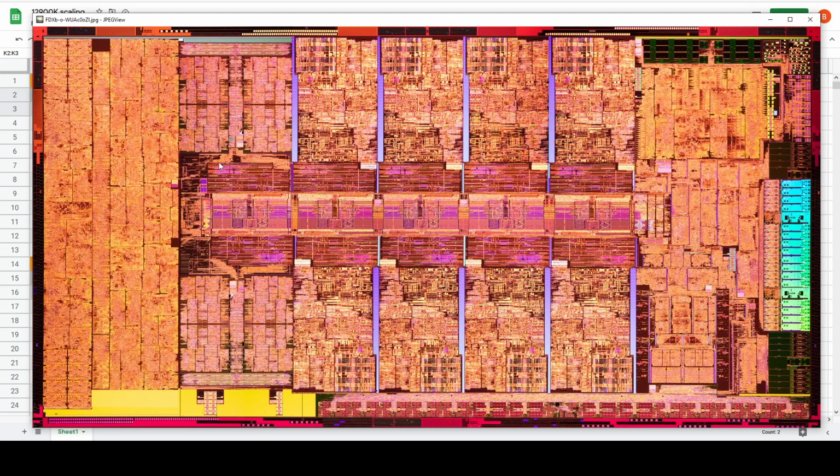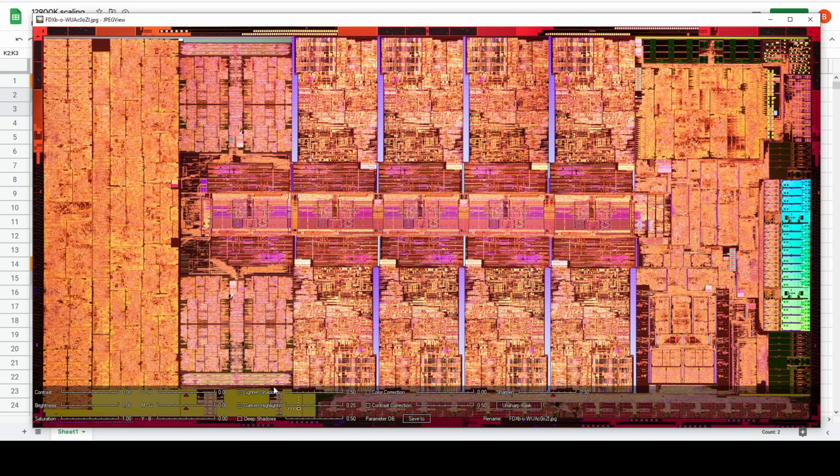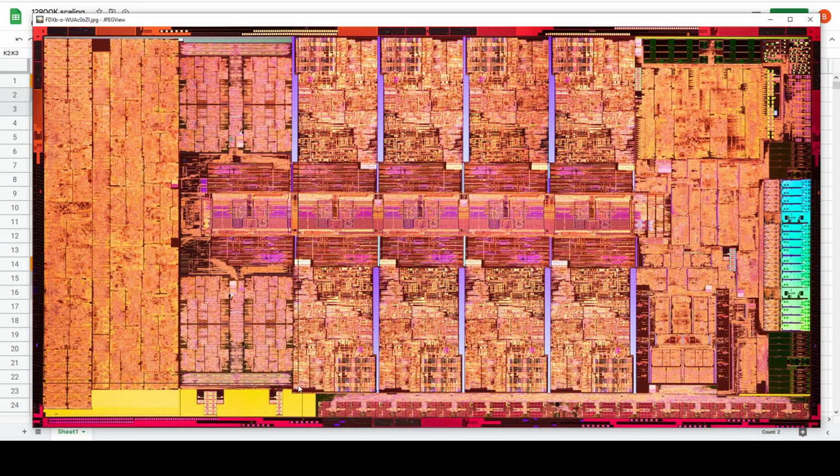because the moment you turn even a single E-core on, your ring clock goes straight to hell, which really isn't that surprising, because the E-cores, and consequently probably this entire portion of the CPU, the iGPU and E-core section of the chip, is there for laptops. I would assume it is optimized for low power rather than high performance.